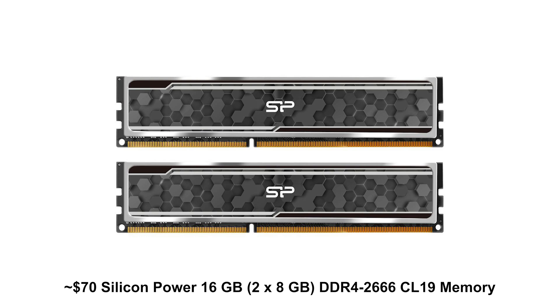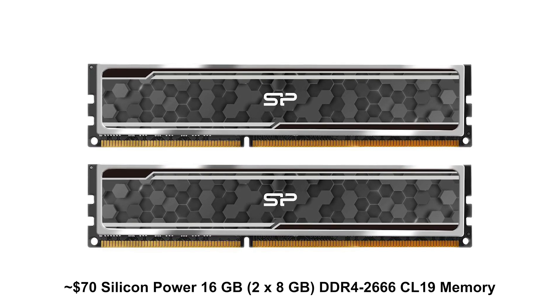With B460 there's really no point in getting RAM faster than 2666 MHz because this platform can't run it faster than that anyway. Get the cheapest RAM you can find that runs at least 2666 MHz to get as much performance as possible. The RAM I picked for this build runs about $70, give or take — check the links below for current pricing. I'd actually recommend looking up RAM yourself rather than just going off the PC Part Picker list, since a different kit may be cheaper a month or two down the road.